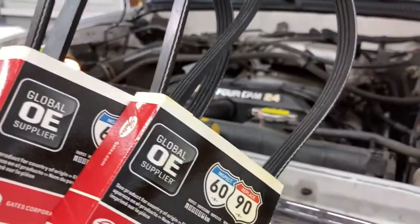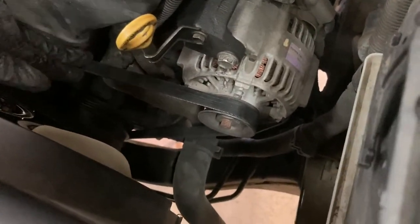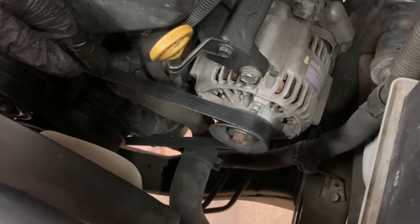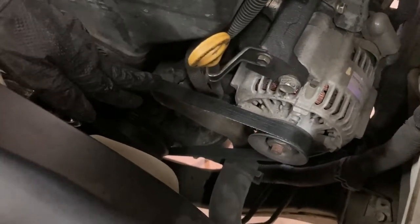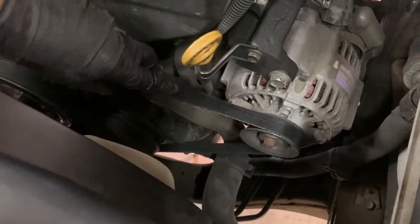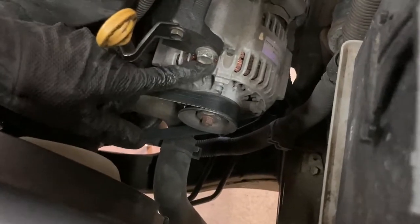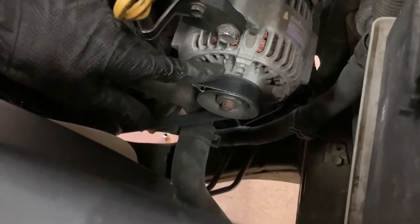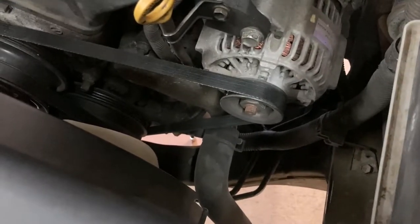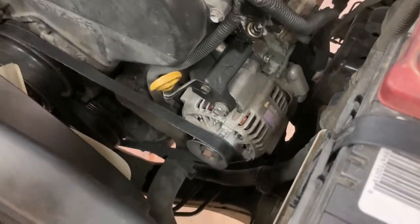Now it's time to get the new belts on. Okay, as you can see, the belts are back on. Everything looks good. I'll need to look up the specs on how much slack these belts are supposed to have. Usually it's around a quarter of an inch, depending upon how long the belt is. I'll also need to look up some of the torque specs for some of the hardware that I've tightened down. You do want to make sure that you don't over tighten some of these, because you could prematurely wear out the bearings. And yeah, so I'll make sure to put all that stuff in the description once I get that figured out.